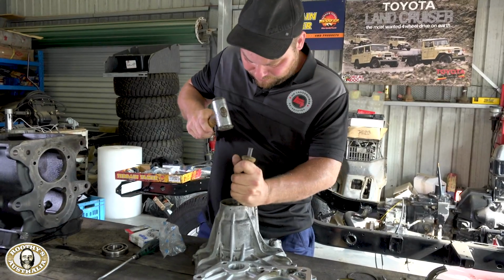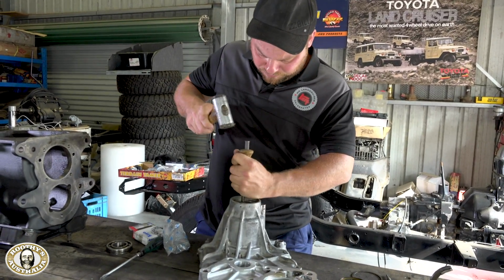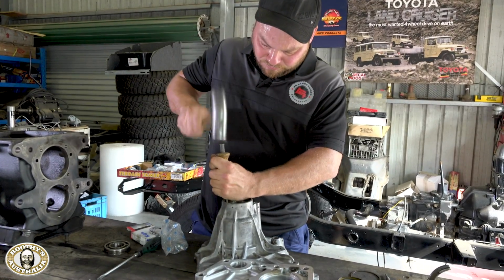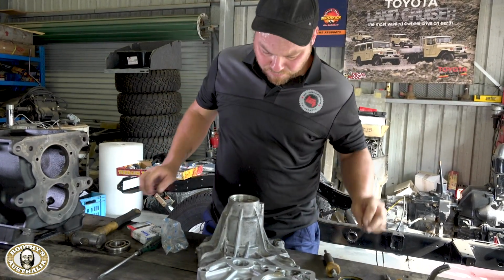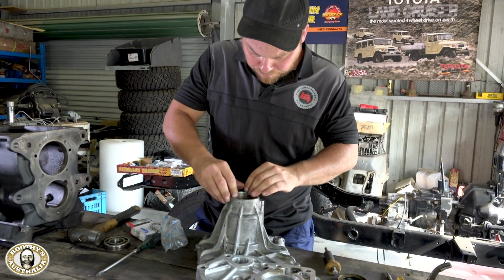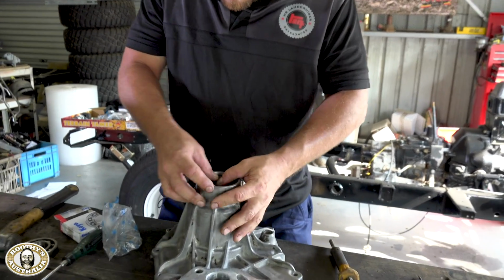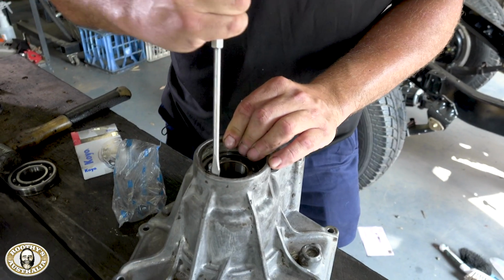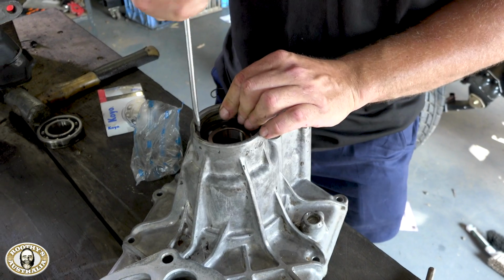Yeah. I did this recently with a set of new wheel bearings, and because it was for the back axle, and it was a little bit tight, I actually cut a gap in the old bearing. It works really well, actually. Yeah, definitely a little groove in it, just so it fits over the bearing and you're not sliding off it all the time. Yeah, exactly, and that way I didn't hammer two bearings in. I could pop it back out.